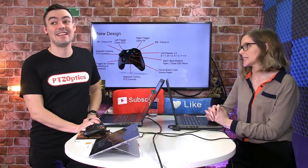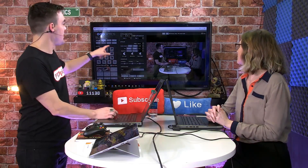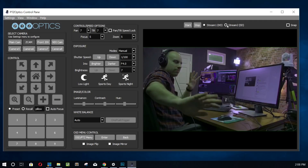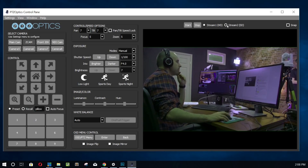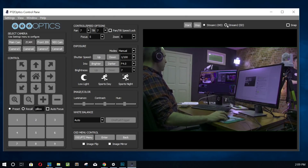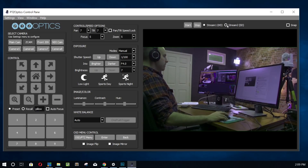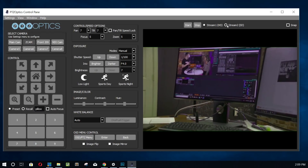What about zoom on the Z cams? Yes, it will work — let's show that off. Let's go ahead and switch cameras to the Z cam here. One of the other things to mention is that we're using VLC to pull in the RTSP video from the cameras. I'm going to integrate a way to change the buffer speed to reduce latency — that will be an option in the next release. We have it at 300 milliseconds to try to reduce latency. I'm going to zoom it in and out. The Z cam doesn't have any pan or tilt, but we can zoom in.